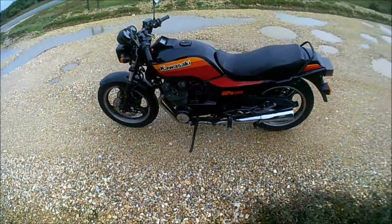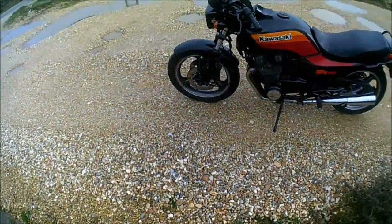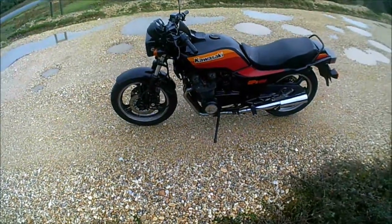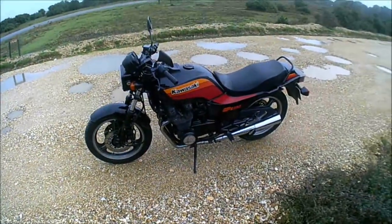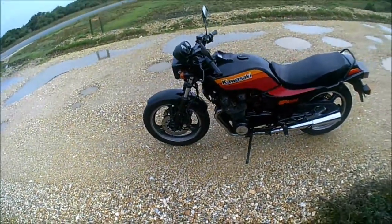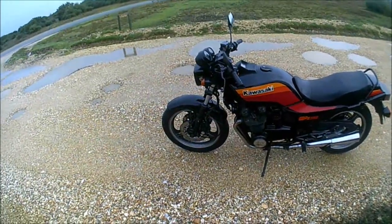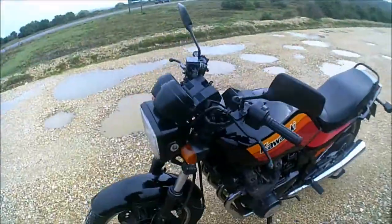And I'll be honest, I do tend to use those on all my other bikes, but this little 550, well, it's 55-60 horsepower, I guess, somewhere around there. And the sort of mileages that I'll be doing on it, this little budget chain and sprockets is absolutely fine. I've done 700 miles on it now, adjusted it twice, and had absolutely no issues with it at all.